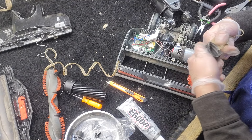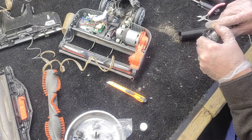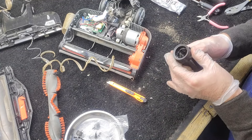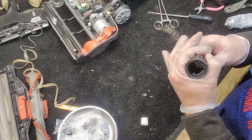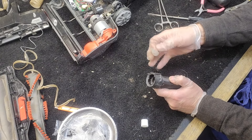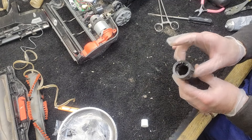Same deal — I'm going to rip all this plastic out of this hose end, then add some more E6000 glue. I'm going to screw that in, trying to get it in just right because it's bulging out a little bit. You'll see where it threads in. So I've got this glued in and screwed in tight. Now I'm going to let it dry overnight, because when we manhandle this back into place there's going to be a lot of strain back and forth, and if it pops off it is a pain to get back on again.